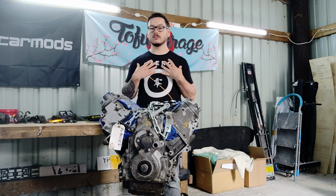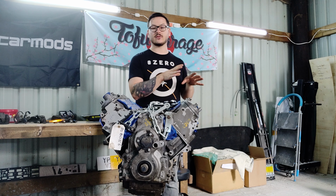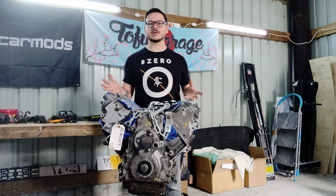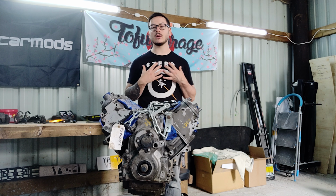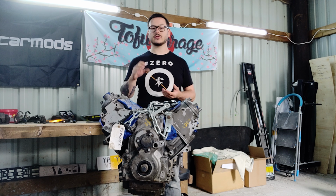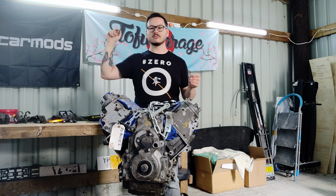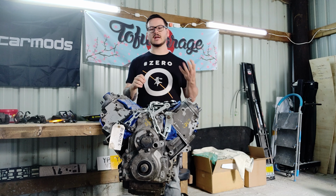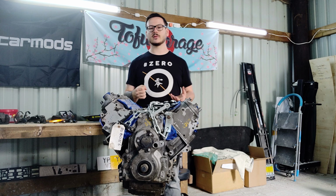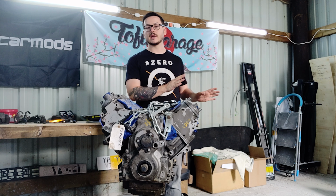And as you guys know, I'd like to do pretty much all of it myself. The main hurdle with the Lexus engine in the 86 platform is the fact that it runs CAN bus for its electrical systems. That can come to plenty of issues when you come to wiring and getting the thing to run and getting it to act like a normal street car, which is what I want. I'm after a normal street car. I'm not looking for a race car where you have toggle switches for ignition and fuel pump and start and all those things. I want to get in it, press the start button, car comes on, indicator stalks work, rev counter works, speedometer works. Simple. And so because of that, the 1UZ was out of the question for me.